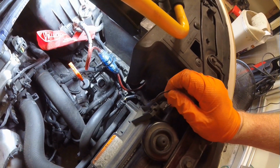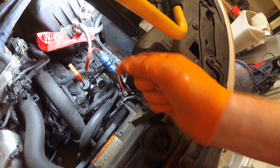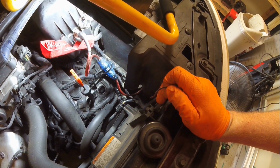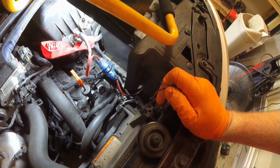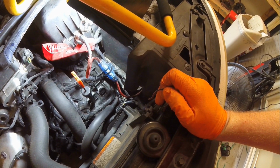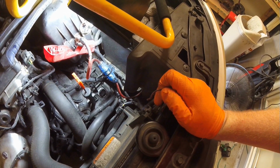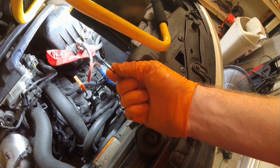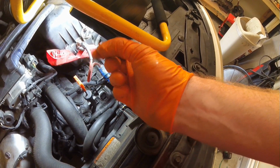But it is quite difficult to get that seated and get this clip back in place. If you look closely at that connector housing, there's actually an O-ring, and that's to make a good seal to the top of the transmission. So when you're placing it in from the bottom side of the transmission casing, you've got to make sure that you push pretty securely to get it to snap into place past that O-ring, and that'll give you enough clearance to get the C-clip on.